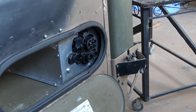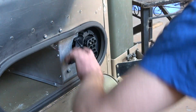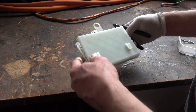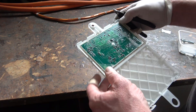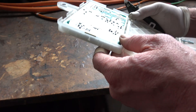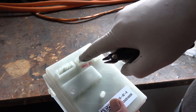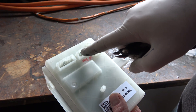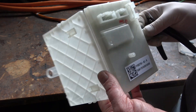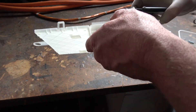I've bent up some thin aluminium sheeting to separate the charge port from the rest of the storage locker. Now for the charge controller - I want to try and make this waterproof. It sits up high in the back corner there, but I might as well try and seal it as best I can. The weak points are these plug holes - there's big holes in there and the pins aren't sealed. It's plastic welded in these spots, so I'll get those out first.